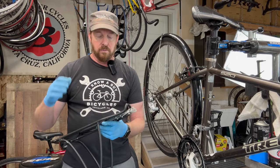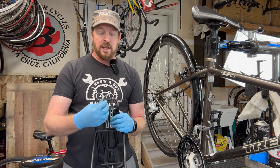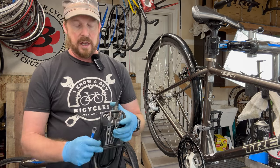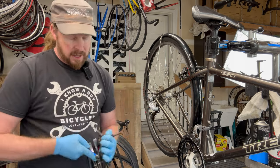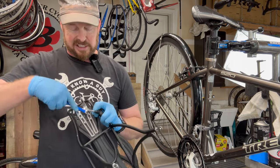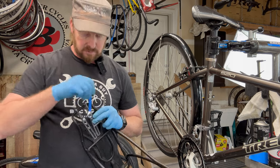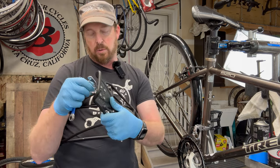This rack is a take-off from another bike. To start, you want to loosen these bolts up here on the mounts so they're fluid — that makes the actual install easier. On this particular bolt pattern, one side fits here. I suggest using a ratcheting-style tool if you have one, because you have to do a lot of awkward-angle tightening, and a little ratchet makes life a lot easier.